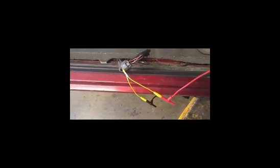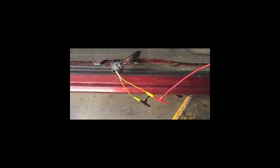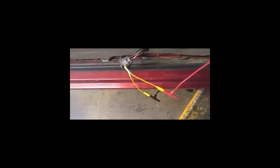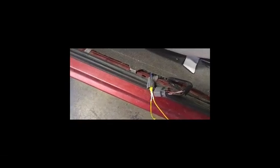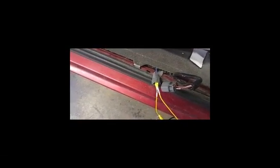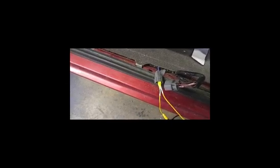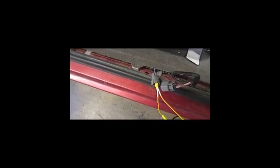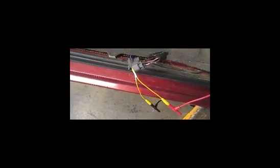Follow it down and around. If you notice down here, we're tapped in. The red wire goes to the voltmeter, the black wire goes to ground — that's the other end of the black wire you saw at the battery. We're tapped into the O2 sensor coming up through the floorboard, so it's now isolated by itself with its own ground via the black wire.